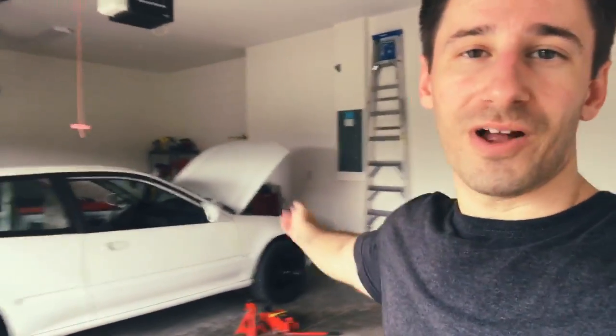Like, as I'm picturing the edit, I hope that goes the way I'm picturing it to. But essentially, you just start at the right rear, the passenger side rear, then you go to the other side rear, then up to the right front, and then the left front. You're just working your way towards the master brake cylinder. And you just repeat those steps for each corner.